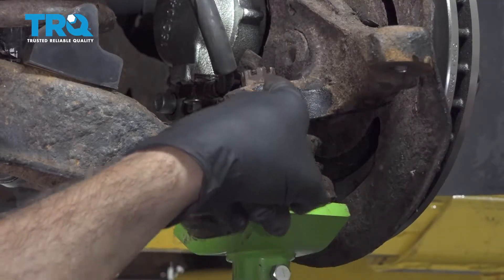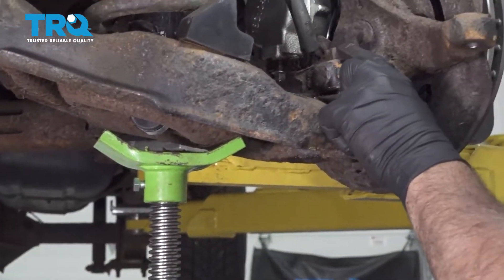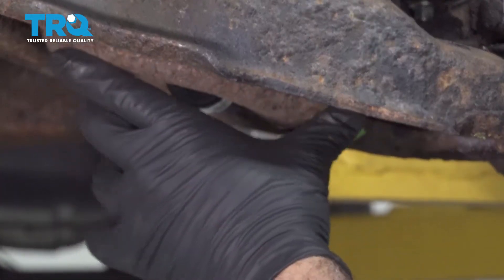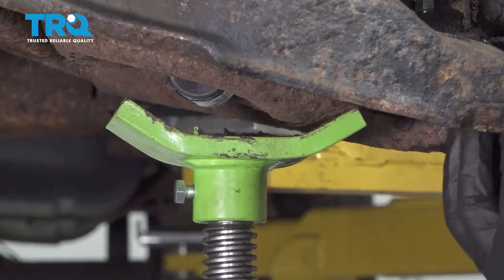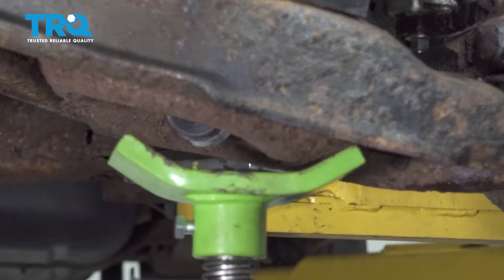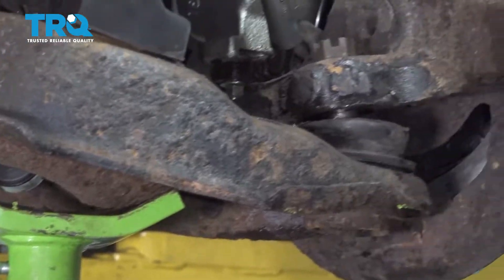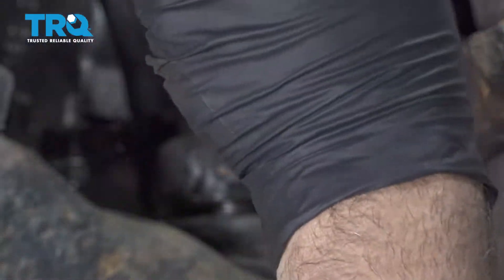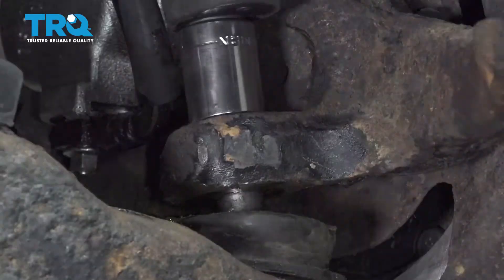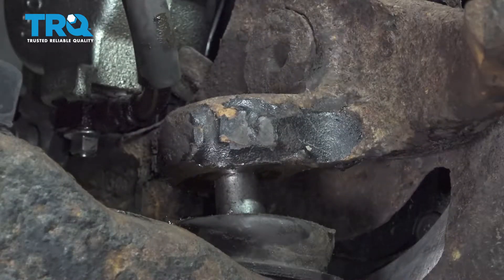You can see the gap underneath the boot — the nut was there to capture it and keep it from launching off. Before removing the castle nut, relocate the jack underneath the coil spring perch. Jack this up a little bit, remove the nut off of the ball joint, and set that aside.